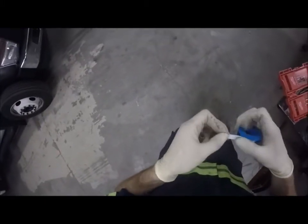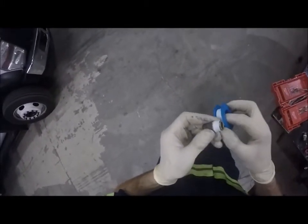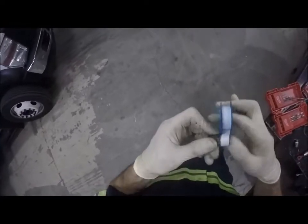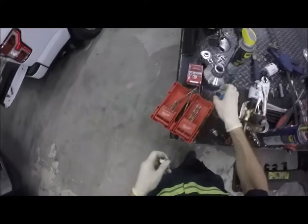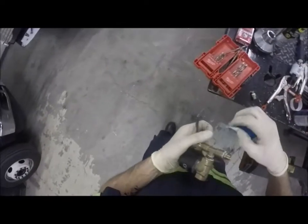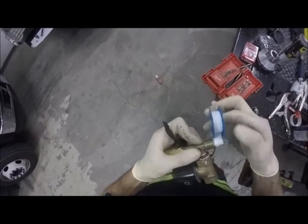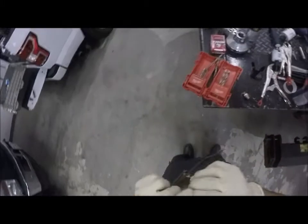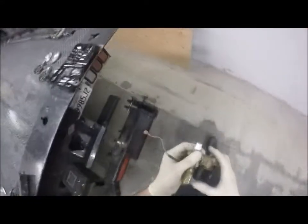This is pipe tape, or what is commonly referred to as Teflon tape. So once you get a wrap around, then you can kind of pull it tight. I'm gonna do about 3 wraps. There's 3. Just break it off. That way, when it goes in there, it'll be fine. And then I need to Teflon that piece. That's the one that's going into the horn. Although no air is going anywhere until the valve opens. I will have to, however, bolt that guy on. So I'll still have to drill a hole for that. But right now I need to figure out where my air leak is anyways. So let's get into doing that real quick.